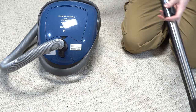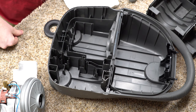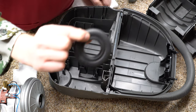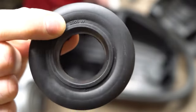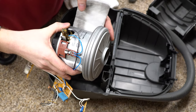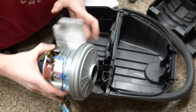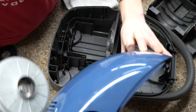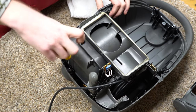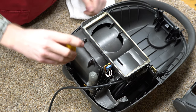Inside this machine is kind of interesting because there's a lot of cost-cutting measures compared to something like a Miele or other things from Europe or some of the Philips. You can see that they were originally sold with a 2,000-watt motor in Europe — of course, here in the U.S. we wouldn't have that. There is sound-deadening material, and you can see everything is kind of one piece. It very much reminds me of a Miele S2000 series machine in terms of how it's made — everything's kind of snapped together, there's only like three screws holding it together. I don't really have any problems with the way it's constructed, especially when it was sold at the $500 price point. I would be ecstatic if they would bring this machine back today and maybe just equip an EBK 360 with it — this would be like a number one selling machine in the U.S. market. It really is a shame we don't get these anymore.